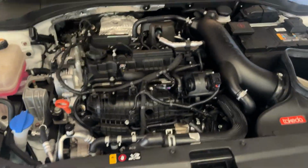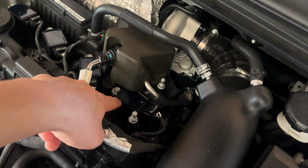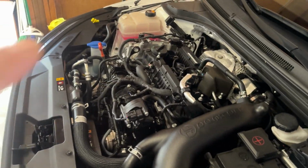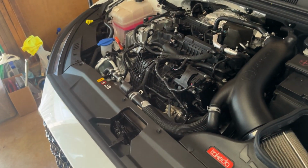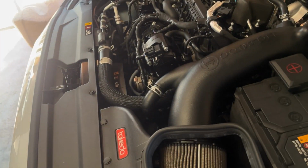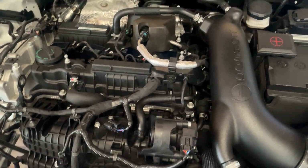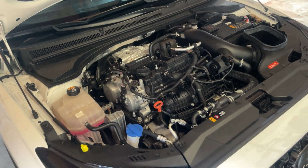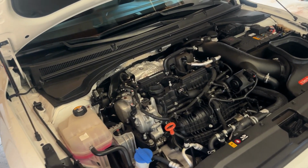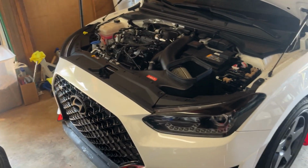That's what I've been told by my tuner, and we checked for spark, it works. For the cylinder that doesn't work, it's just unfortunate. I loaded, it blew up, in air quotations, on a Monday after loading a tune file. No, it was not my tuner's fault. It was an off-the-shelf map, I think it was like Stage 1++, and it's a known thing that the injectors go out after you flash a tune file. I was doing like 50% throttle just to feel the difference, and then it just went, and I was like, oh, it blew up. But then after diagnosing it, it's just the injectors, hopefully.